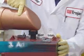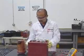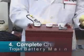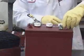Three: if necessary, add just enough water to cover the plates or to cover the bottom of the built-in indicator. Four: next, put batteries on a complete charge before adding any additional water.